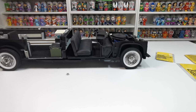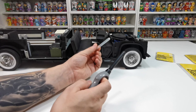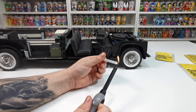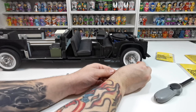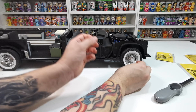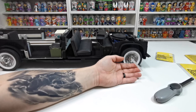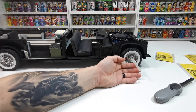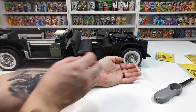There are a few ways of removing the center caps, and the most effective method I've found is using a glue stick. If you want to keep the caps undamaged, this is probably the best method. Heat up the glue stick until it's hot — you don't need to leave it long — then as it's piping hot, pop it onto the center cap, push it into place, and hold it there until it goes solid. This method should work without damaging the center caps.